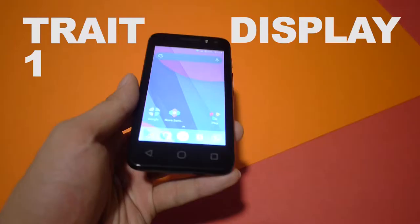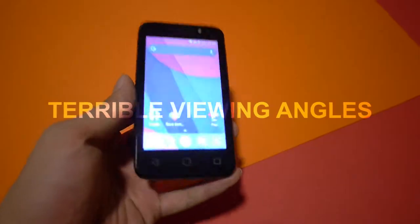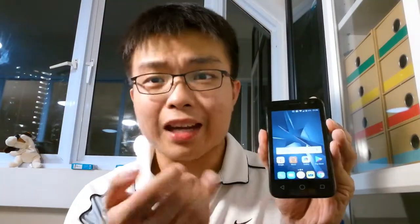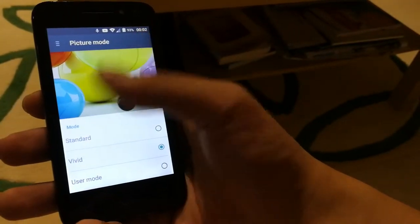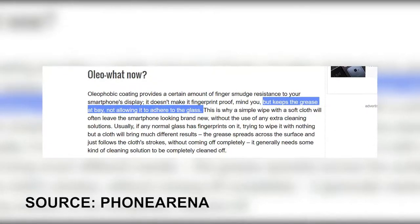Compromise one: the screen. On many cheap phones the displays usually have a decent resolution, usually 480p. However, a 480p screen on this is very different from a Samsung Galaxy S screen from 2010. Cheap LCD panels always have this trait of terrible viewing angles. Usually the viewing angles get very washed out or very contrasty at a certain plane. And at the same time they're usually not so saturated and contrasty — colors look pretty muted even on the boosted color options in phone settings. The glass on these low-end phones can be worse as well — either the distance between the panel and the glass is quite big, or the screen has no oleophobic coating to prevent fingerprints from sticking. This one doesn't have too big an issue with the former, but the latter shows up the moment you use the phone — look at the difference between this and that.